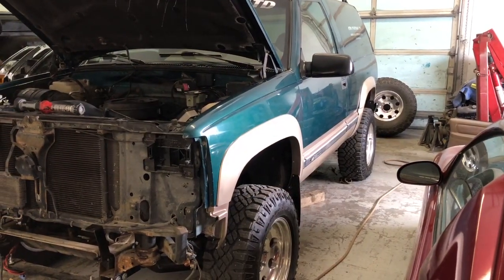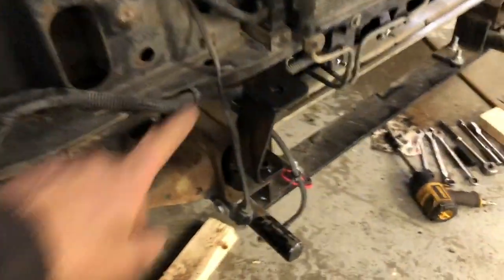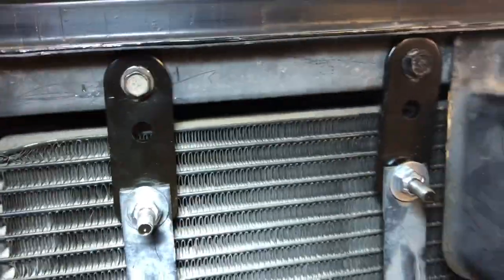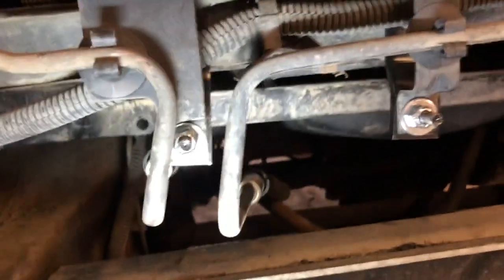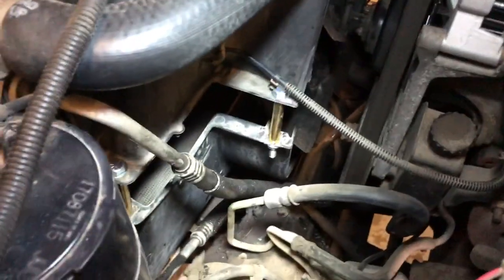I currently have a three-inch body lift installed. It's actually pretty nice and easy. I highly recommend spraying everything with fluid film — that has saved all the bumper bolts; not one bumper bolt has broken on me. I have the new bumper brackets installed. You also get another bracket that raises up this one here so it matches your other bumper brackets. You get two little drop brackets to drop your transmission cooler, two more on the bottom, and two more on the inside to drop your bottom radiator shroud. Then you get four spacers to space your shroud out — and that's basically the front end.